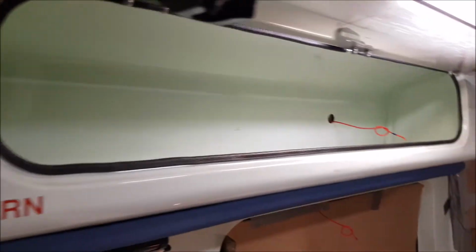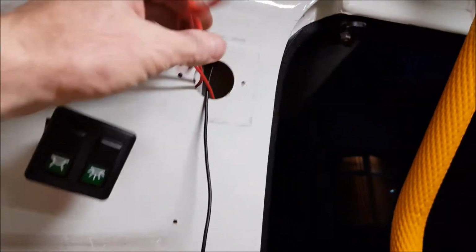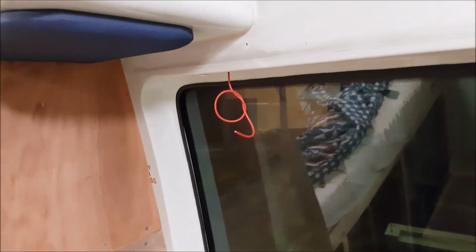But what we've managed to do is put in draw wires everywhere we want them, and for the lights, and again on the other side in the locker. We're going to end up with trunking along the locker, or in the inside of the locker, to make it easy, because we just couldn't get a cable to run that length without hitting too many obstacles. And again, a little bit of trunking in this other locker to join those up, come down for lights above each window. Then we've managed to get cables through the trunking down to the bottom, and so that's where we can run the 12 volt from for that side of the van.